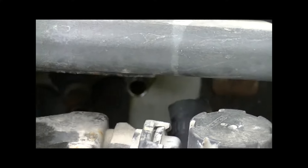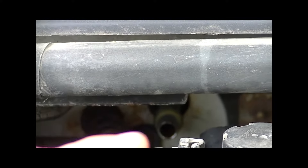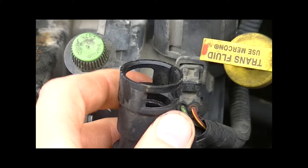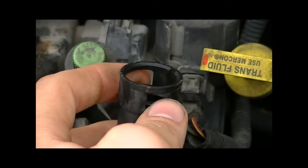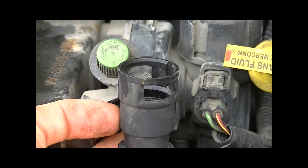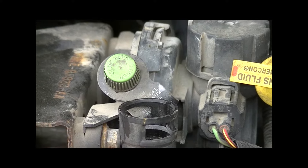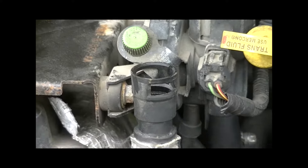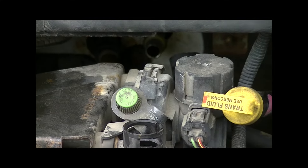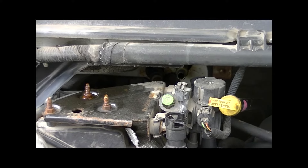If you get the actual toolkit to do it, it simplifies things. Basically there are Teflon hooks in a spacer with a couple of o-rings, and you've got to push the tabs to allow the fitting to slide off. Before disconnecting hoses, you definitely want to drain your coolant system, which is recommended for vehicle maintenance anyway. Drain your fluids first, then disconnect the hoses.